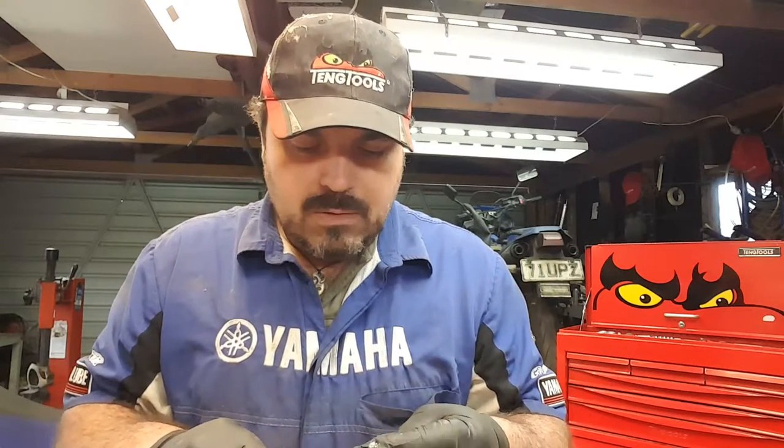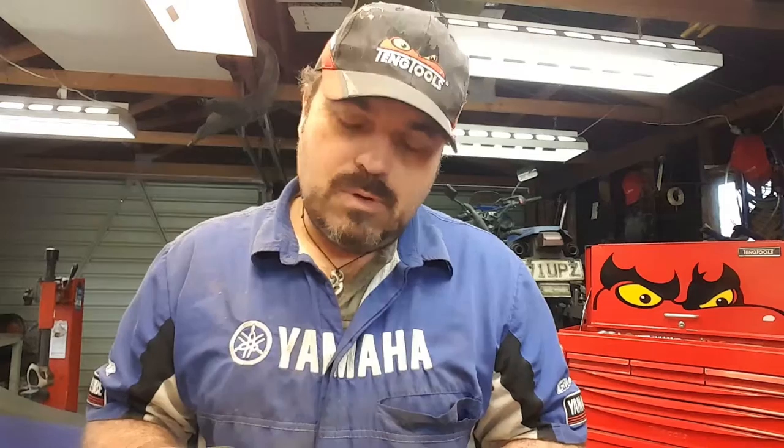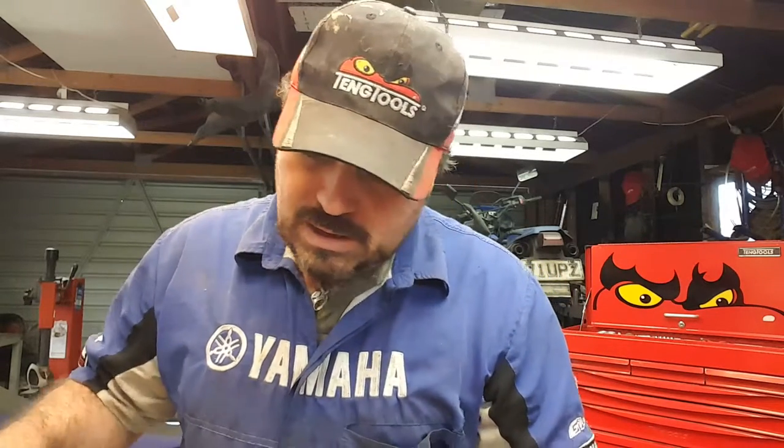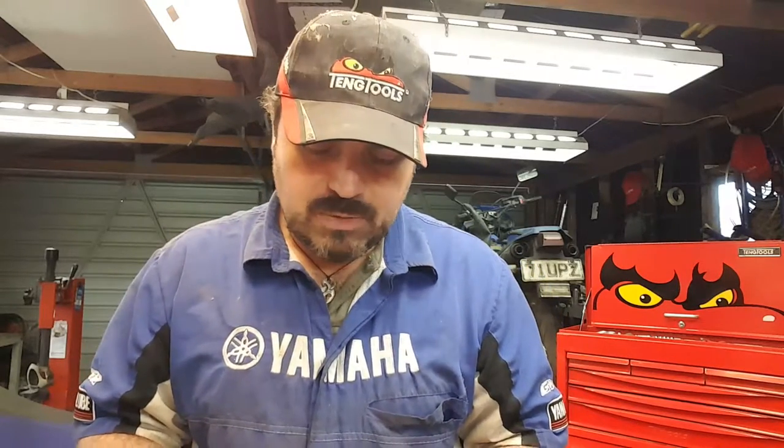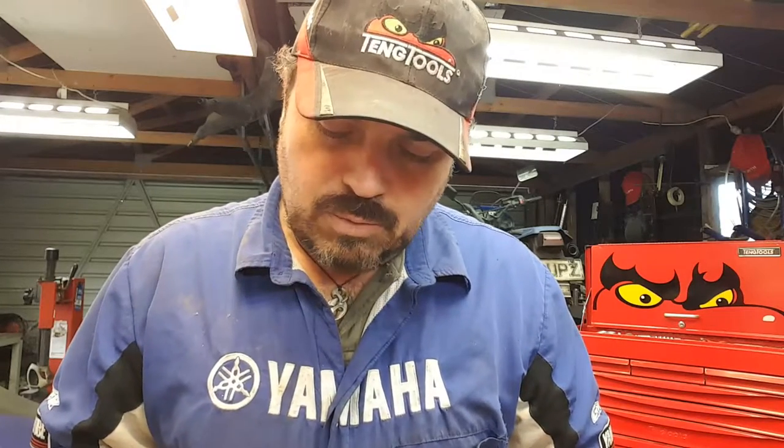Now, if you're buying these off eBay or Amazon or wherever it is you're getting them from, be sure not to buy Chinese spokes. Crap, to be honest. We used to have a really big problem in the bicycle industry, and nearly all the wheels are built in China, unfortunately, but they suffer from what we call spoke rot. So you're a lot better off making sure you're getting a good quality Japanese spoke to replace the ones that you're putting in. Otherwise, they won't last anywhere near as long.